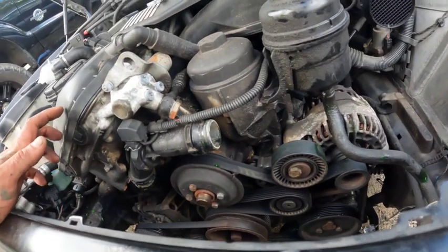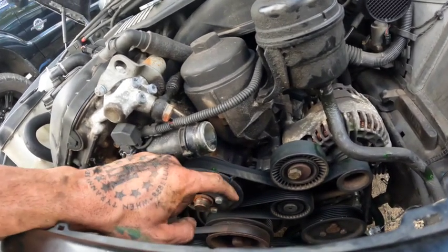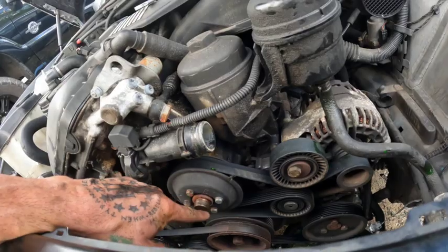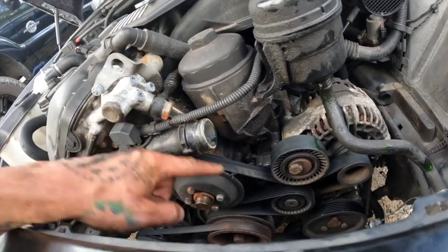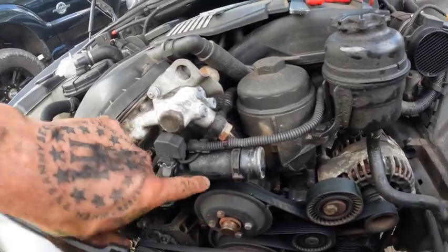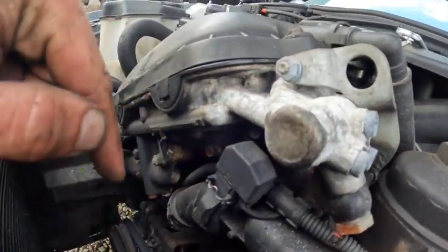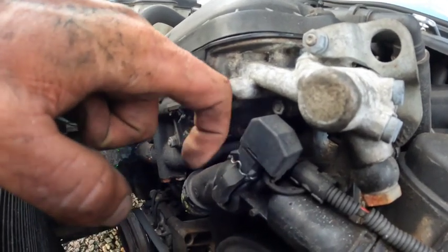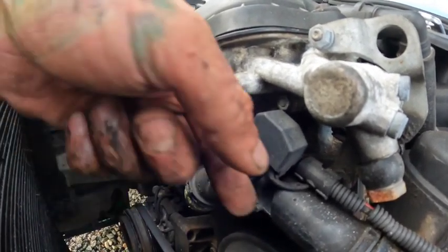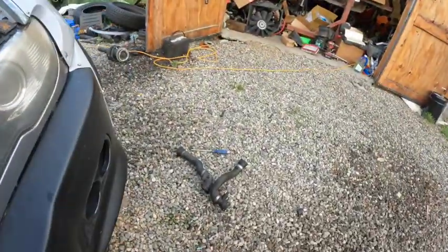So next, I think I'm going to loosen all these bolts here, take off this pulley because we have a replacement pulley going on. I bought an aluminum flywheel one, and then take off this housing because we got everything for here. But what's super nice, here's another clip. So all the coolant hoses and all the clips are held on by these little lock pin things. So you just pull these out, pop them off, everything comes out. I was surprised on how easy it was to get those off.